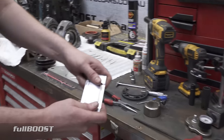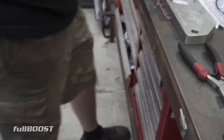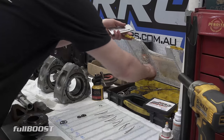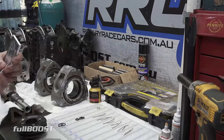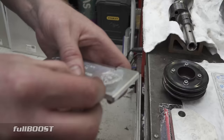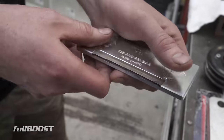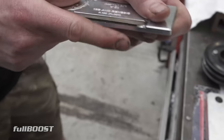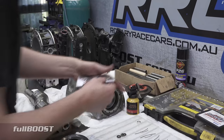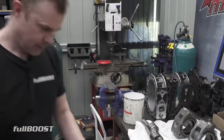This tool is for measuring apex seal width. The apex seal fits in here. Sometimes when you get apex seals, they're not always exactly spot on. Using this tool, you can see it fits in there perfectly. If it doesn't fit in there, it's just a simple case of machining it on a block and getting it down to the right tolerance.